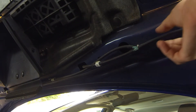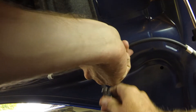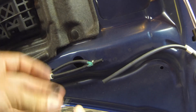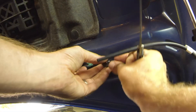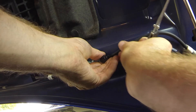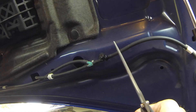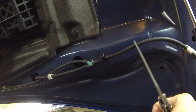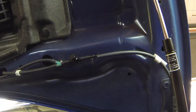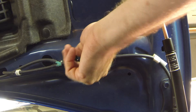Once you pop open the hood you'll see up here where the misters come up and it splits. I'm just going to cut into the hose right here to make a little point where I can tap in, using a sharp knife. I'll put a valve in between to stop the flow and regulate it, then put it back on the other side to continue the flow, and then put in a T — so now we've got the T in there.